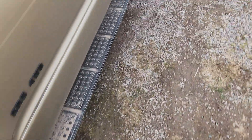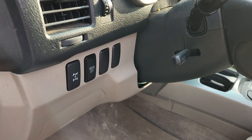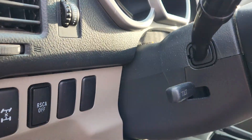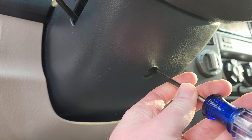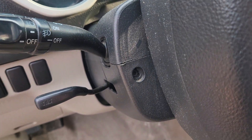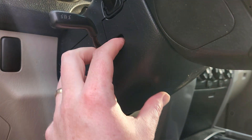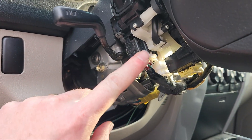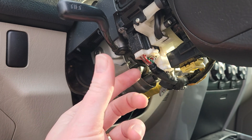For this next step, we are going to make the fog lights work independently as well as with the high beams. This lower cover needs to come off. We're going to have to get the Phillips screwdriver out. There's one Phillips here, and another over there. With all three screws out — I've already loosened mine — just pull that off. You might have to pull kind of hard. The clip we're going after is this one here. Ignore the yellow and look at this white one back here. I'm going to disconnect this and show you what two pins you need, then we'll vampire clip them together.